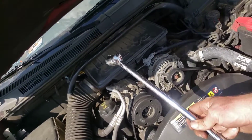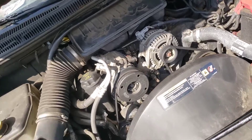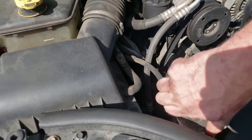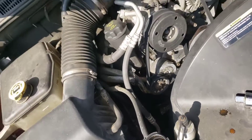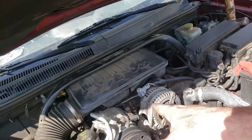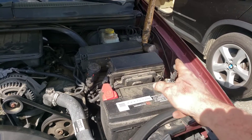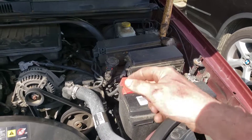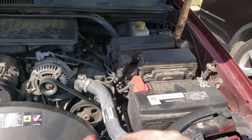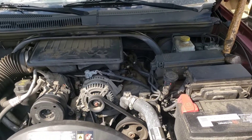Take your ratchet — in my case this breaker bar — and be super careful putting that back on near the alternator wire. This car hasn't been running; look at that, no coolant in there, so definitely have to add coolant. Tighten that up, again just snug. Clear your code — if you don't have a scanner you may be able to just disconnect the battery wire to clear the code that way. If not, just plug in your scanner and hit reset for the codes. And that's it guys, not too bad of a project. Thank you all for watching and I'll see you next time.